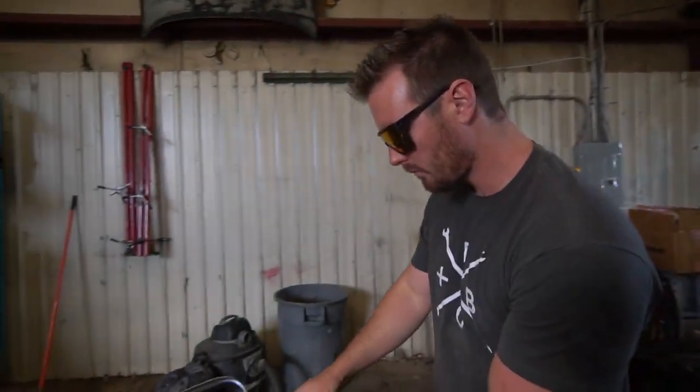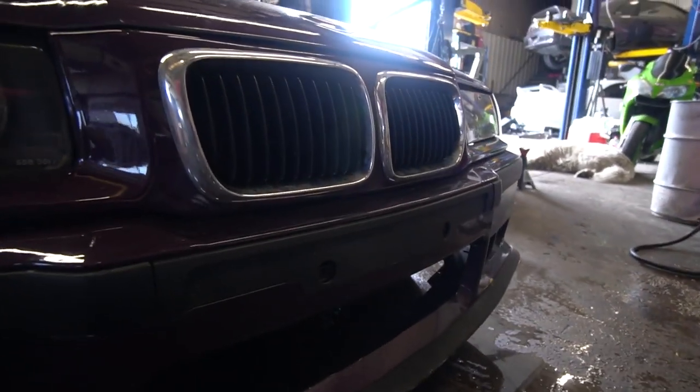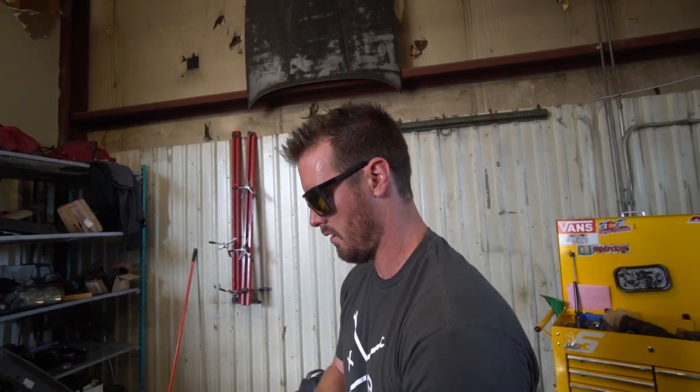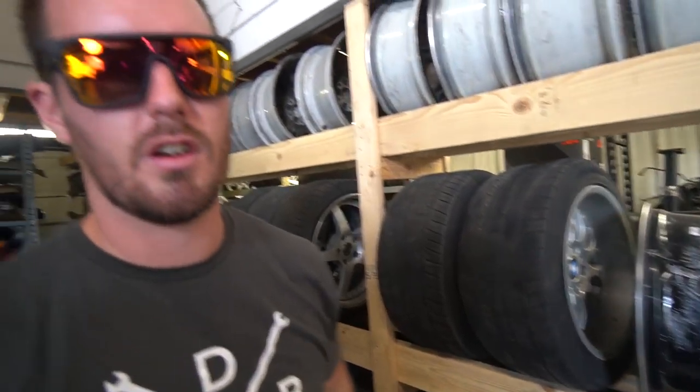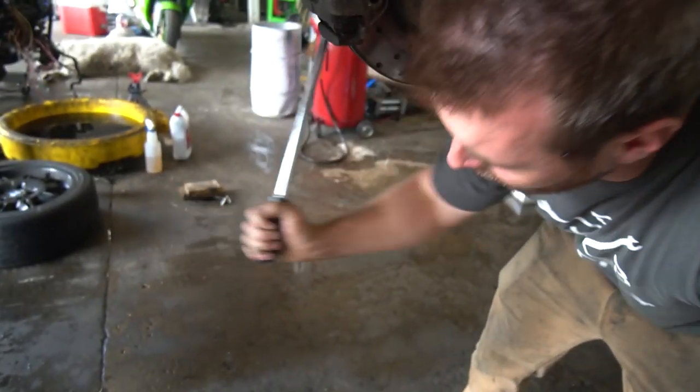There you go — a little car Christmas for you. It has grills as well — we cannibalized those off another car. I don't know whether we're gonna post that video, but I have a spare S52 now sitting right there, and I'm pretty sure I'm gonna be putting that in the E30 M3 because the one that's currently in there is pretty tired. I'll put a fresh motor in it and have a little more fun before we do the N54 swap. Back to this E36 — full disclosure, I didn't actually know whether I bought the E46 M3 CSL rotors or the other option. One allows you to run 17s, one does not, and I can't remember — so I guess we'll find out.